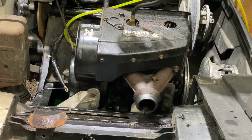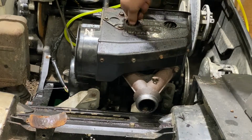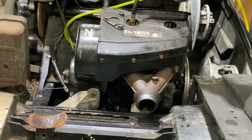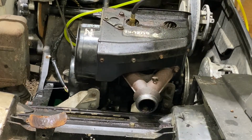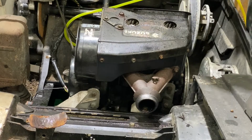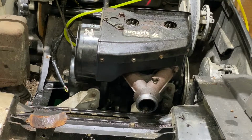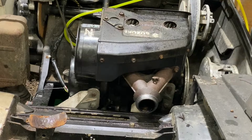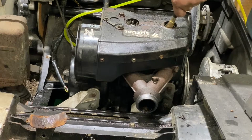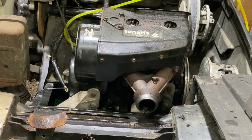All that, and we still have 75. I thought there's also no oil in it. Throw a little WD down the cylinder. Yeah, it's at 75. The throttle's wide open. Well, the throttle's supposed to be wide open on a compression test. We're just putting a little bit of WD to lubricate. That should theoretically seal the rings a little better. I'll pull it over a time or two.